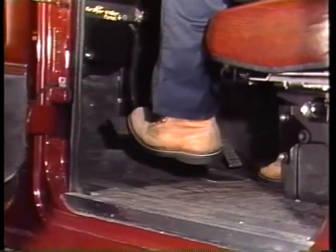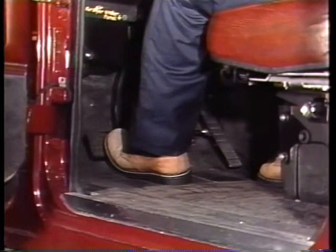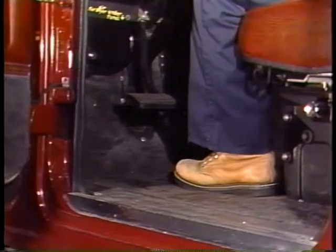To do this, step on the pedal and push it to the end of travel while someone observes the release lever. When the clutch pedal moves, the release lever must also move. Motion must not be lost between the clutch pedal and the release lever.